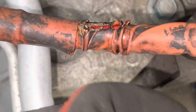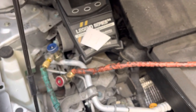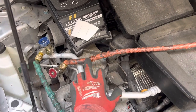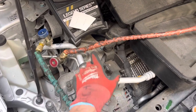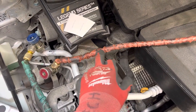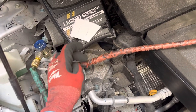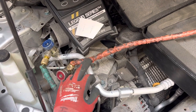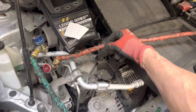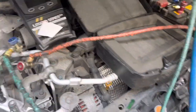Because I had so much silicone grease between my shrink wrap and my hose, it really didn't burn that bad. With a lot of experience of hoses popping from touching aftermarket tube-style exhaust manifolds on race cars, you can burn right through a hose in two or three minutes. But this did not burn through - I was on there for 10 or 15 minutes. It turned black, but it took so long because of the high-temperature shrink tubing and the thickness of the silicone grease, which can go up to 400-600°F temperature range. It finally cooked through a little bit, but it still didn't pop. These hoses lasted longer than any I've done since I did this modification.